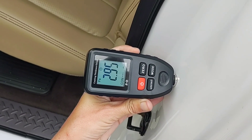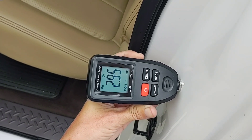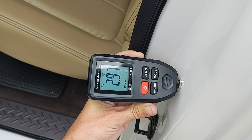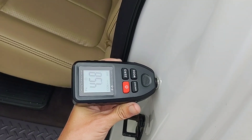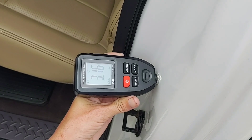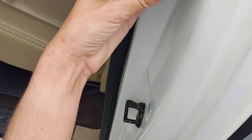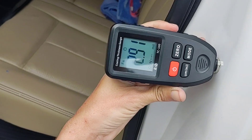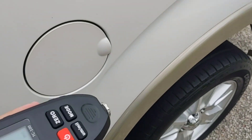Right here's a good area. 2.95 to almost three mils. You see when it fluctuates like that, that's me moving it on an angle — it has to be perfectly flat. In certain areas it's a little bit thicker. What you do is take a couple readings and just get an average. Right there was around three mils.